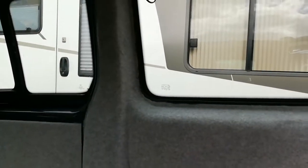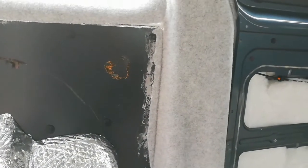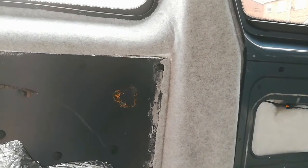and in fact the middle pillar, we put the silver foil thinking that it would even it out, because there's a lot of dips in the bodywork, but actually what it did was not give a firm surface onto which to glue the carpet, and therefore it looks a little bit on the wrinkly side on that side. On this side we didn't put the foil bubble wrap under the carpet, but just covered over the holes and gaps with foil tape, which gave a firmer surface for the carpeting, meaning it went on more smoothly with a better end result. I say we, but I do of course mean Mick, as he took on this job in its entirety.